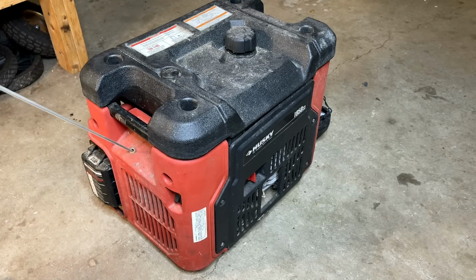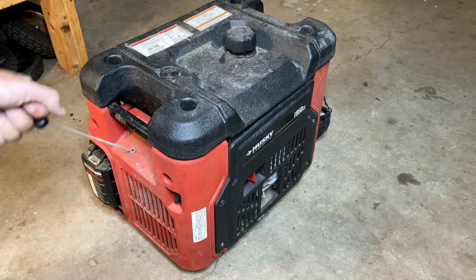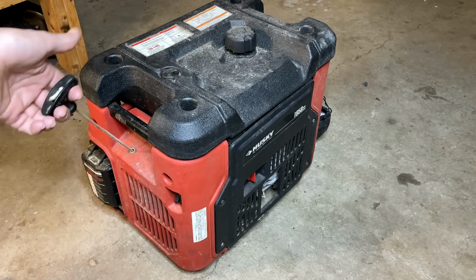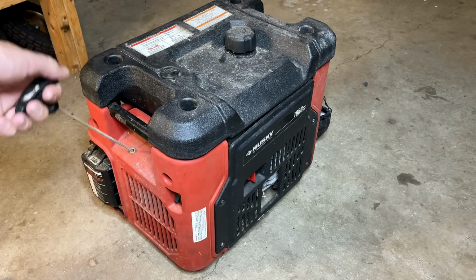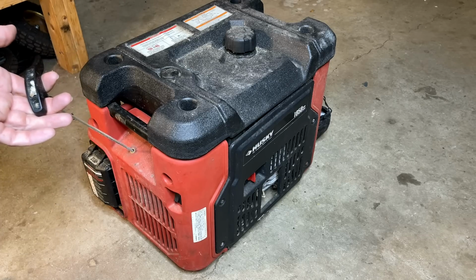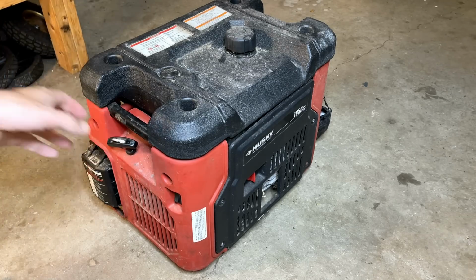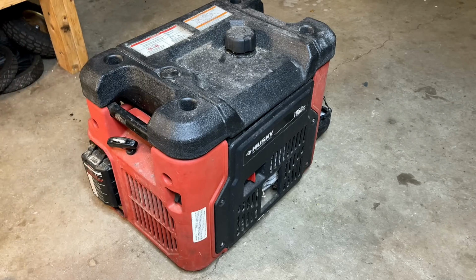When pulling this engine over, I can tell there's very little compression. At some point, I should hit the compression stroke and the engine stop advancing, unless I apply more pressure, but in this case, it keeps going. And I don't want to say the compression's zero. I do feel something, but I think it's way too low. So I'm going to start by getting the compression tester on there and seeing where we're at.